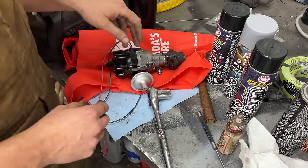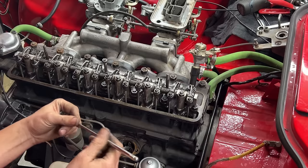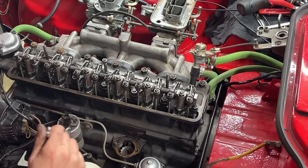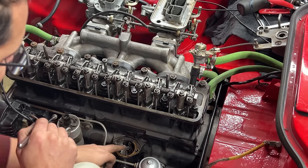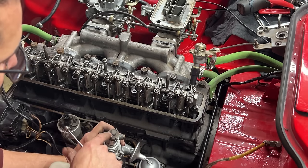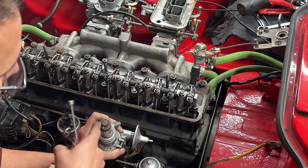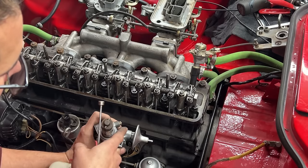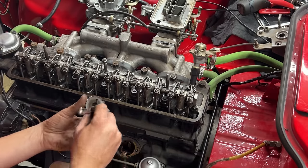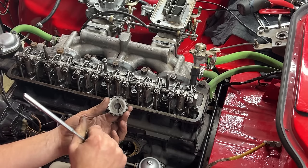I know that many of you have seen this on my channel multiple times, but there are many of you who are new to the channel, so that's for the new people. This distributor drive gear has a slot on top which engages with the tail of the distributor, and remember how we said that this key here is not directly through the center, it's a little bit offset to one side. The same of course is valid for this gear. You see the slot where this key goes is offset to one side.